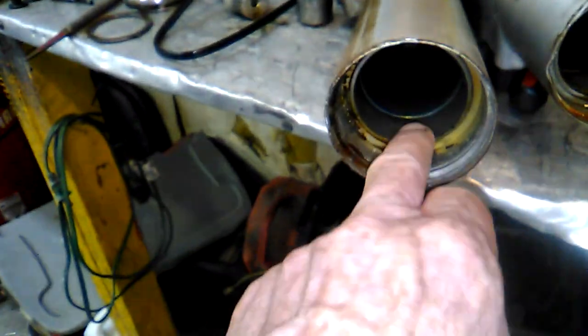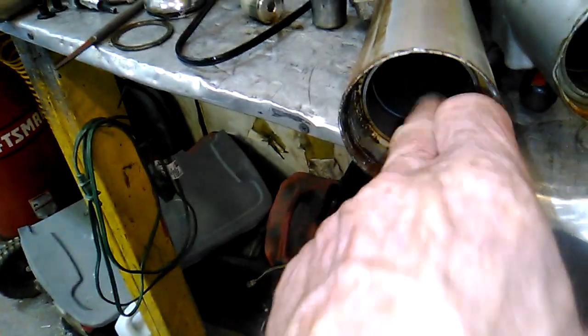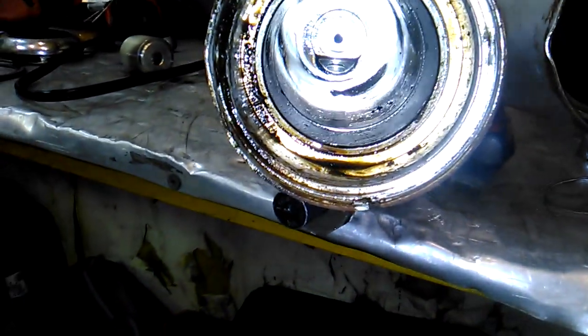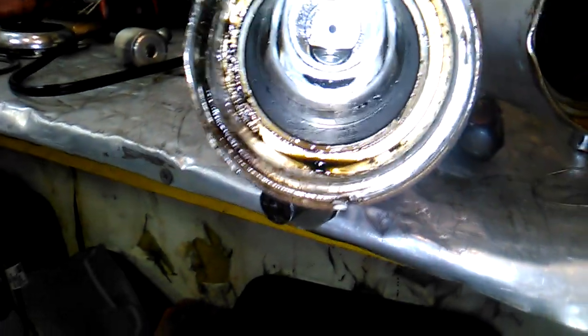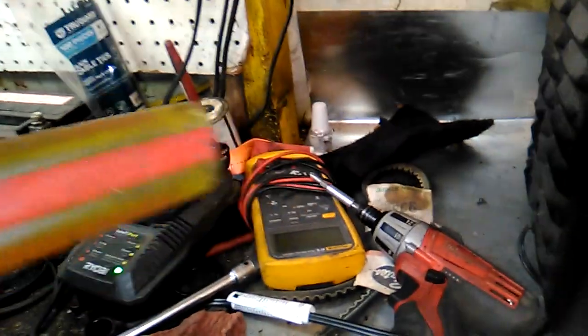And then the bushing, sometimes these bushings will actually slide out. Push them back in. They need to stay in there. And then clean the very bottom of the tube down there. Dirt and debris accumulate down there. A lot of times I'll take a long screwdriver like this guy here, stuff a rag on the end of it, and make sure I get all that stuff out.